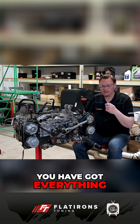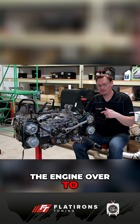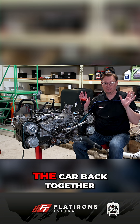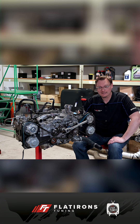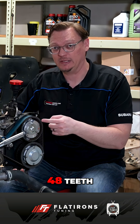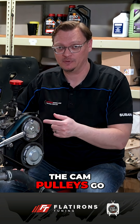When you're doing a timing belt, you've got everything lined up — how many times do you have to rotate the engine over to verify that all the marks on the timing belt line up? The pulley that drives the timing belt has 24 teeth, the cam pulleys have 48 teeth. So for every two times the crank pulley goes around, the cam pulleys go around one time.